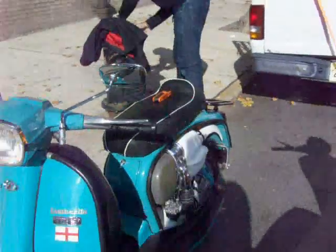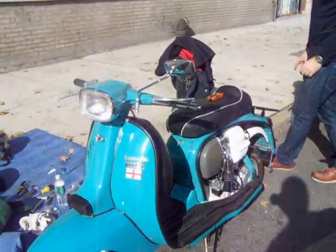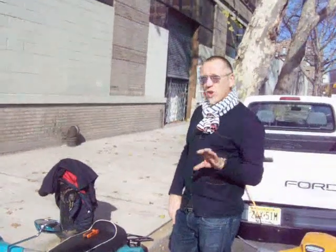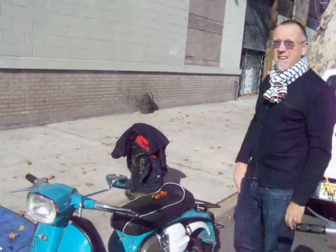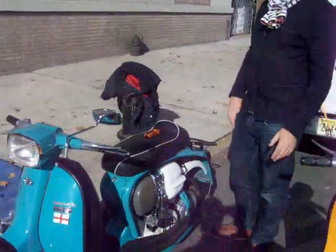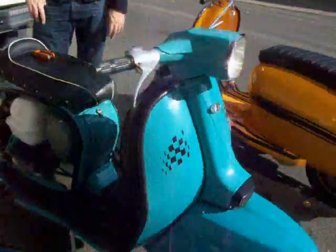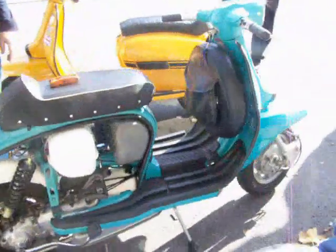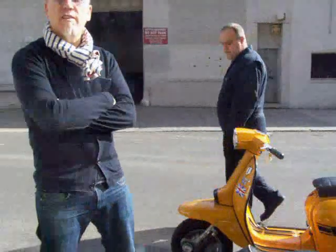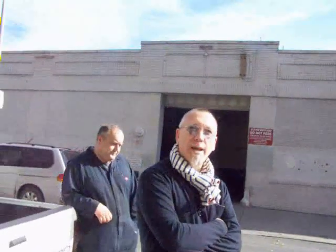This is a 69 model, the DL125 — the smallest engine displacement they made. It has shorter gears, so it's very nippy around town, whereas the GP200 has taller gears for the countryside. Tony has also put a kit on this one, so the displacement is now 185cc, and he's put a bigger carb on it — 25 mil as opposed to the stock 20 mil — so it's got a little bit more pep.